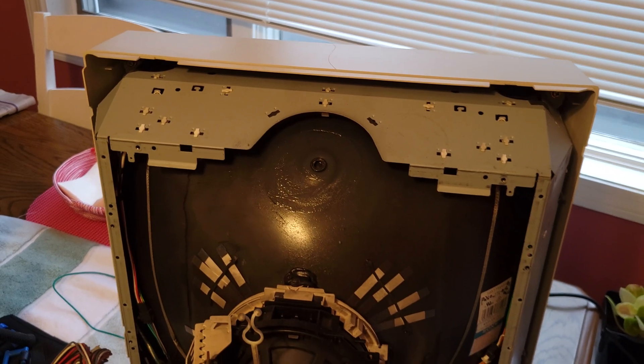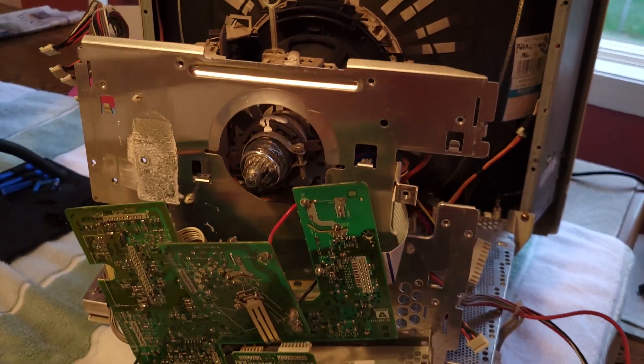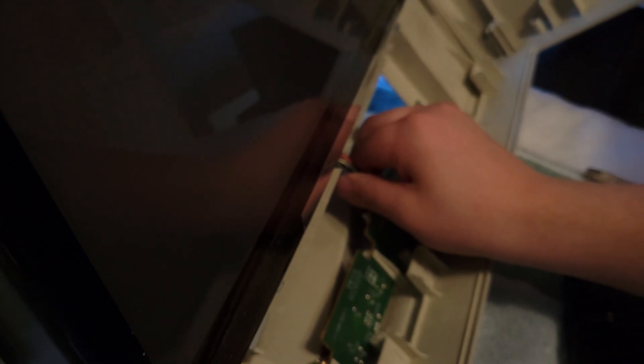These things suck ass. These are obviously the giant screws that hold the tube itself with the bezel into the chassis, and it sucks to remove it. But after you do that, this is what you've got to work with — it's like the shield and stuff. Once you remove those screws you can just take the bezel off, but don't just yank it out. You're going to want to angle it down because the OSD buttons and front panel stuff will be connected with a header cable — it's very small, so there's a good chance you'll yank it and break something.